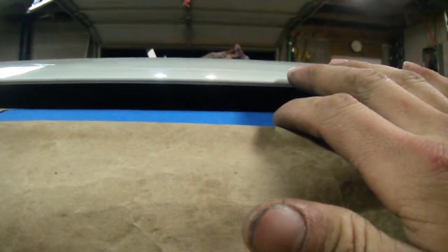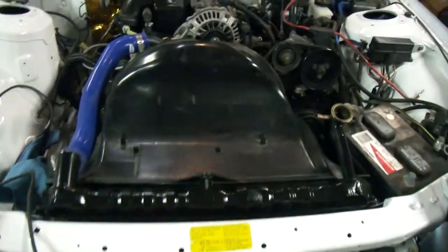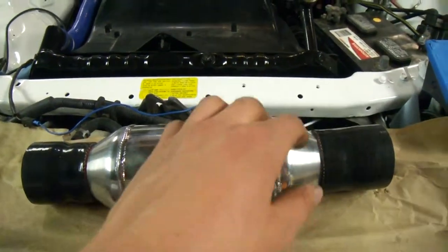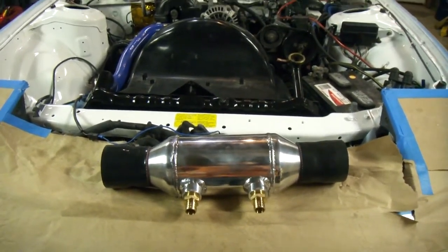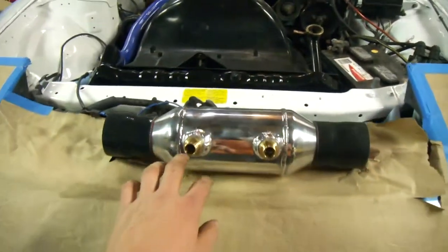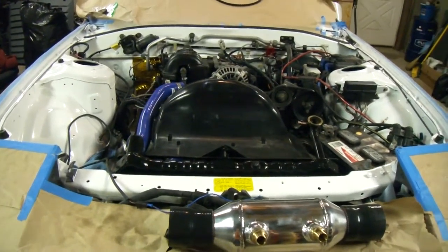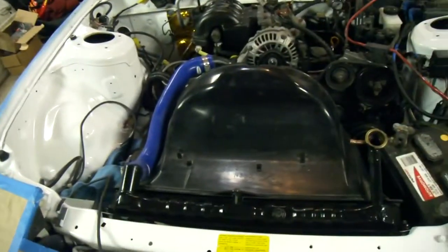I'd like to go far enough to where when I shut the hood it doesn't hit. I've marked two straight lines basically where the meat of the taper starts. I'm going to make a rectangle and gradually the rectangle will grow as I lower it in there. Most likely it's probably going to have to sit down to about where the coupler is to clear, and I can always lower the shroud a little bit too. I'm probably going to be making a pretty decent-size cut in here. If I end up having to cut a decent amount of the sides too, we'll do that - can always find more stock FG shrouds, lots of people taking these off cars and putting electric fans on.